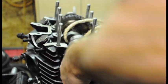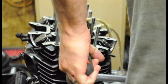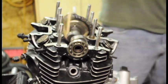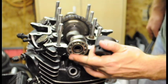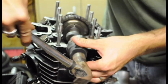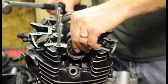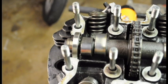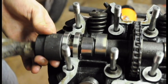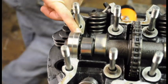I'm going to take my driver, put it inside the shaft, lifting up and gently tapping the bottom in. I've got a one-and-a-quarter socket and I'm using that to tap it around the very edge, moving it along the outside. One bearing is on — I'll slide the other one on here, going along the outside. There it is, seated in. See how we're lined up on the grooves — there are little notches; you don't want the bearings to go in any further than that.